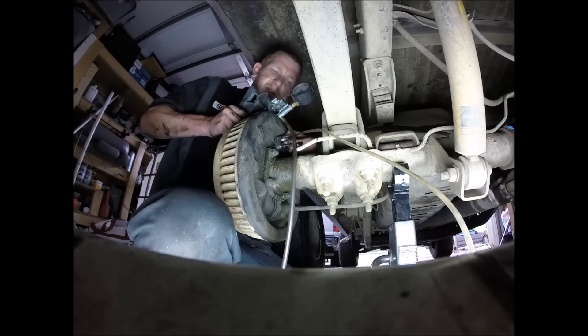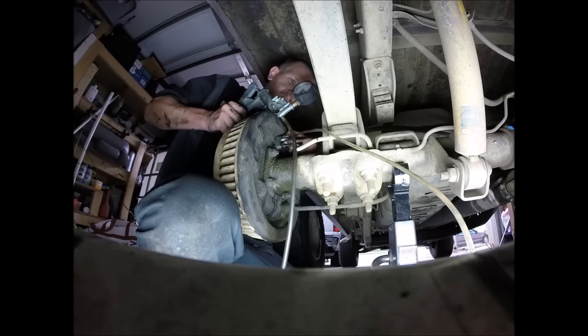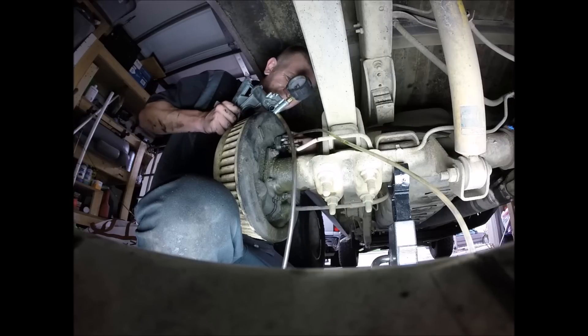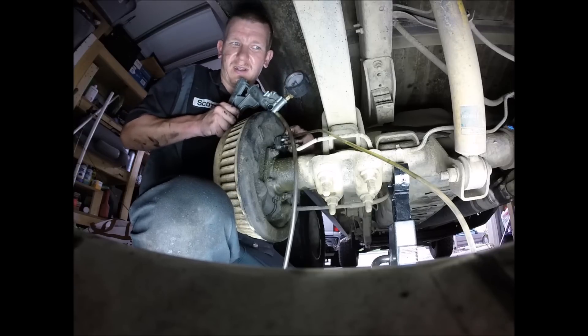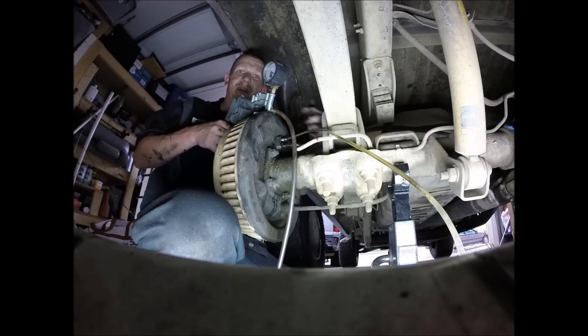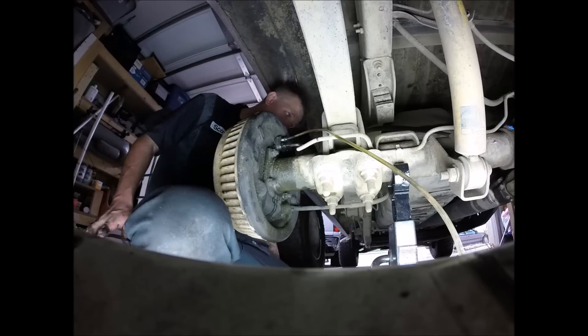See how it's coming out solid — that's perfect. Right now I'm not getting any air bubbles in this system. And since the return hose is submerged in the brake fluid in the little bong thing I made, it's not gonna allow any air to get back up into the system. So now I'm comfortable with tightening this up and being good to go.